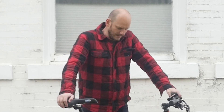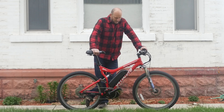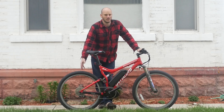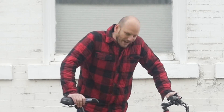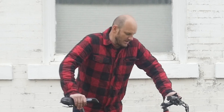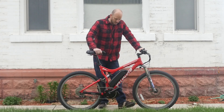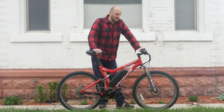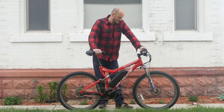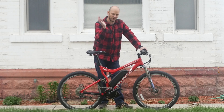You can see the hill climb — this bike performed admirably. Top speed was about 31 miles per hour. I bet I could get another one or two miles per hour if I filled these tires up a bit more; right now they're at the lowest end, rated between 30 and 60 PSI, so this thing is just plush — like riding a Cadillac. It's got a 44-tooth chain ring, so if you put that down to a 36 or even a 28, this thing would be even more of a wheelie machine. It bucked me off the first time I tried — I had to get down low just to stay on it before it would go over.